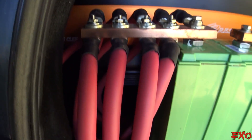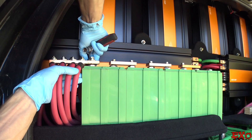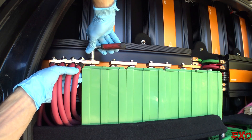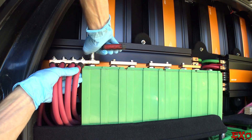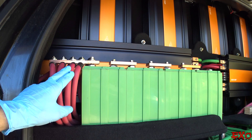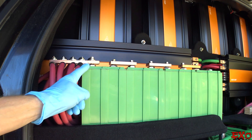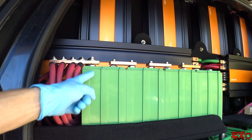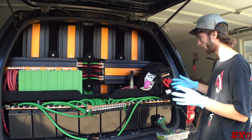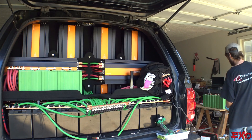We have a safe distance. Move this terminal over just a little bit to keep it parallel with the rest of them, and then tighten them down. Remember, never over-tighten your battery terminals — I know it's very tempting to reef on these with a lot of force, but don't, especially if you already have a lock washer. Let that do the work; that's why you added it there in the first place. That means we're ready for our last lithium battery, so let's grab it and put it in.